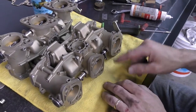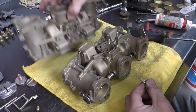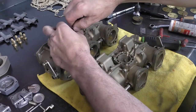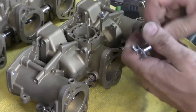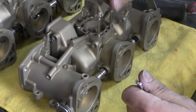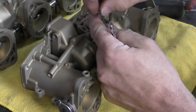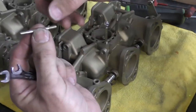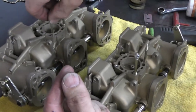We're going to go ahead, get our studs in, set up the pump, and then drill this piece in. We'll use the double nut method to wind these down until they seat. There is a short side and a long side on the thread, so you need to make sure the short side goes into the housing. You can see on this one this thread is longer and this one is shorter — the short one is the one you want to screw into the housing.